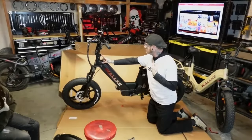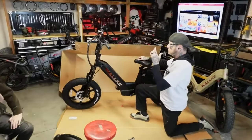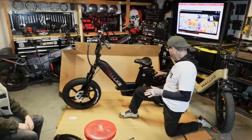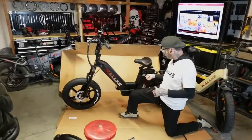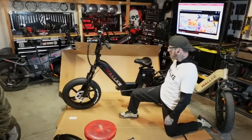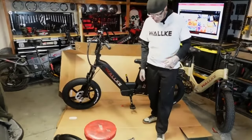There's already blue Loctite on this clamp, which is a good idea. A lot of the bars go into tension clamps so the tension keeps the screw in — I haven't had issues there. I kind of like the simplicity of having only one battery: I'm not plugging in two chargers at the same time. That battery is nothing to sneeze at so I wouldn't worry about range. These folding pedals aren't my cup of tea since they're on the petite side — I like to stand up and ride, so I swap to the big Race Face pedals.